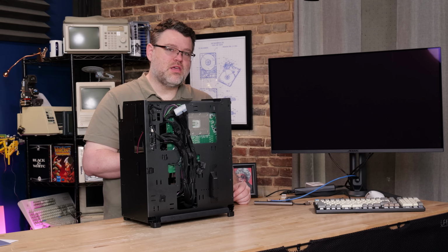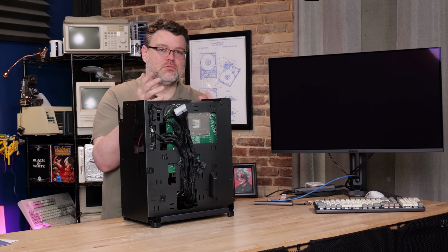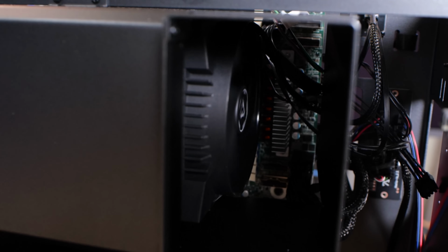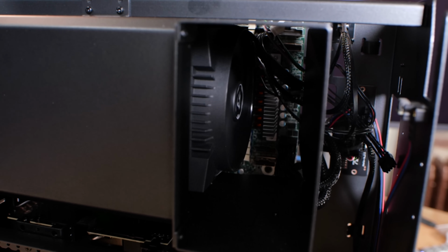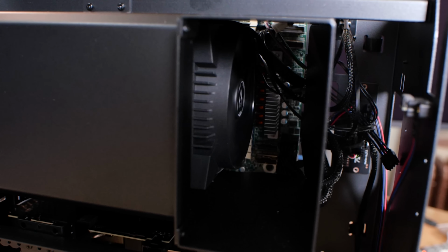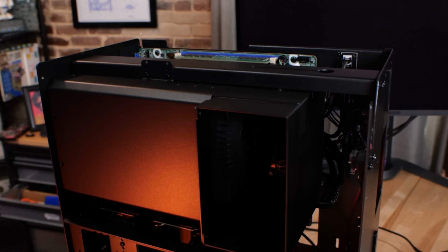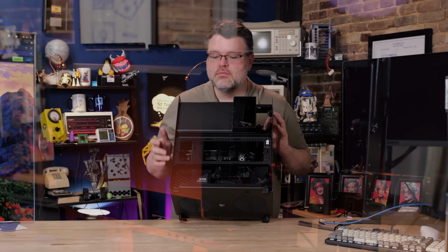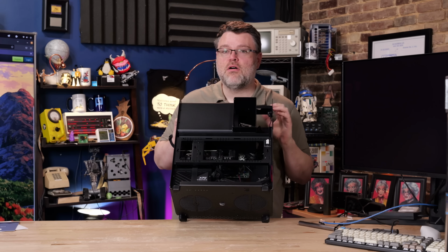You also see this with AMD EPYC motherboards, where there's some ASRock motherboards that are 12 volt input only, and you only have the little control cable for your 24-pin standard ATX power supply, if that's the kind of power supply that you're going to run. This design uses an Arctic cooler, which is awesome because Arctic has always been really good to the builds that I've put together. And we can see that we've got a fresh air intake baffle from the side. And this is all metal construction. They've also brought out a few extra fan headers, should you need to run more fans on the side, all the hookups are here for that.